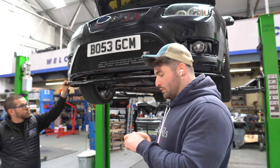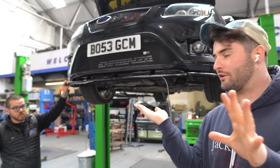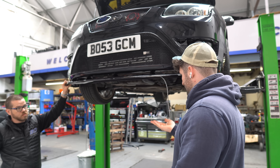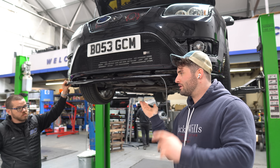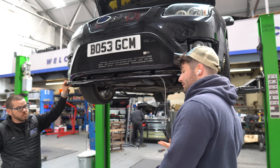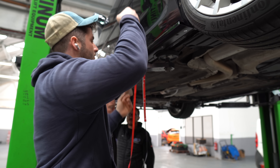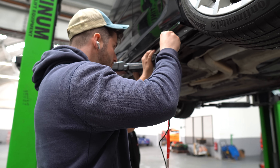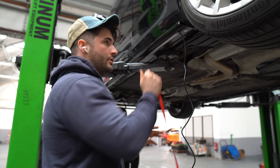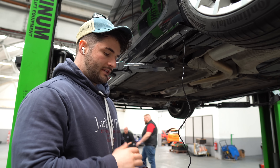One of the first things you'll notice with the AutoBeam underglow kit is these tiny little rubber brackets with the dinkiest of screws. Those are going to be used to hold what the self-adhesive probably can't manage on its own. With all weather conditions and vibration, it's going to be sensible to have these screwed in. We're going to try them out and see how well they fix. We're now trying to evenly space it onto the side skirt — about two and a half inches off each side, which is perfect and very even. The joy with the side skirts is those tiny screws can go right into it, adding security without affecting the look visually.